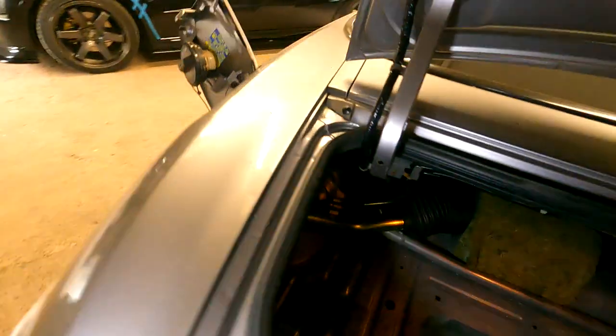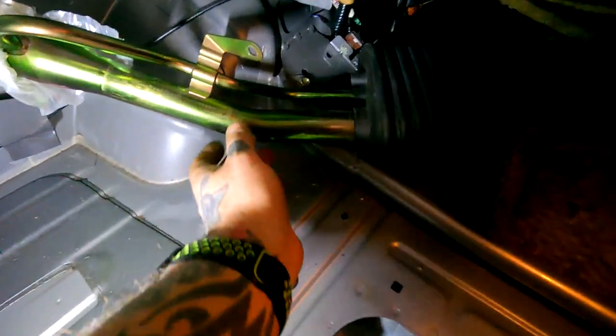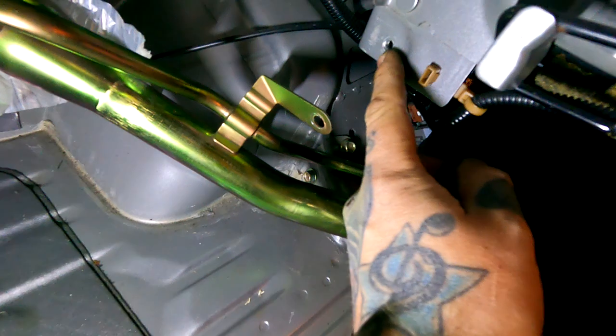see, is underneath all the fuel filler pipes and stuff. So you have to take out the three bolts there, which removes that, and then you can pull that out the way, because it's rubber. Oh, there's a bolt there as well, which holds that bracket on, and then you can pull that out the way, which enables you to get down there. It's a bit of a bitch, that one.